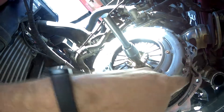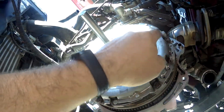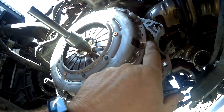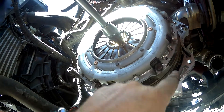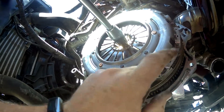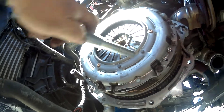I did a star pattern with the six bolts, doing about three turns then jumping to the next one, slowly sinking it on. It's fully flush now but just snug — as soon as there was any amount of feedback I stopped. The clutch is in there, so we can pull the alignment tool out. It should still be lined up, which is a good thing.